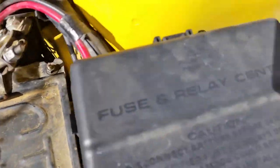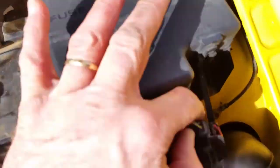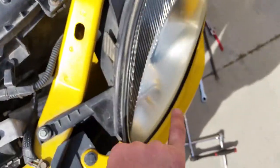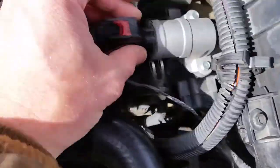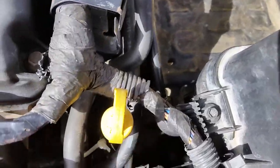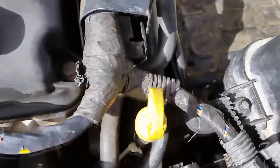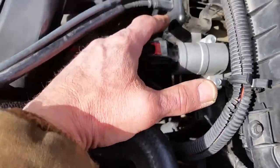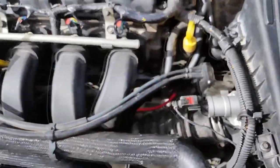Air box is back in, getting ready to put the battery tray back in. Remember to plug the air temperature sensor in and connect it back down into the intake. The wire here goes back to the idle air control valve — make sure that wire is plugged in. Got a vacuum line down here and a vacuum line down here — that's part of the PCV, the positive crankcase ventilation system on the Neon, which we may do some stuff with down the road. I haven't done a catch can on this and haven't had the issues like Subarus tend to have, but you never know.